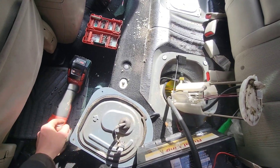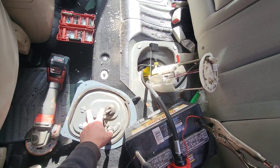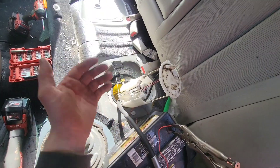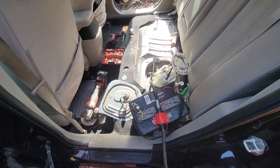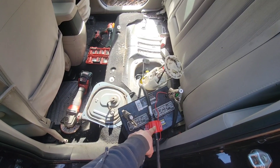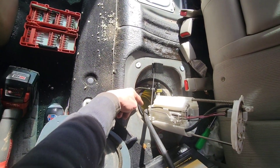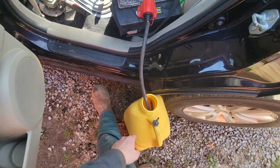So it was actually very easy. You had the three screws in the top of the plate that holds this cover plate on. And then you have eight screws that go around the housing to hold the housing down. And then one connection on top — you just pull up on it and it pops it out. I got a pump for $30 from Advance, an extra battery I had, just plugged it in all together. Have one hose in the gas tank in the low spot, sucking all that out, and have it flowing across and going into a catch can.